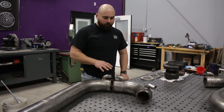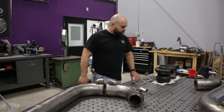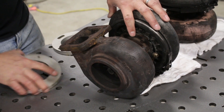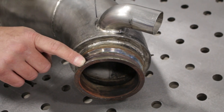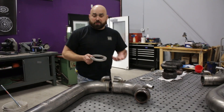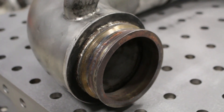That's it for this part. Part two, we are going to be taking these turbines apart, putting them in the lathe, and removing the V-band and adding a much beefier flange onto the backside — we're going to weld this on. The last thing we need to do is cut off a certain amount of these flanges and add the new flange. This will make it more reliable and guarantee that the V-band flange will not snap off again for any reason. Thanks for watching, and consider subscribing if you like this content — we upload every Friday.